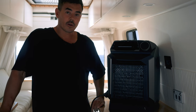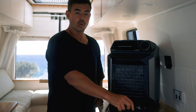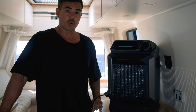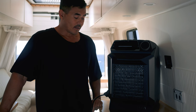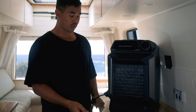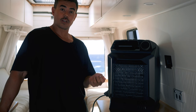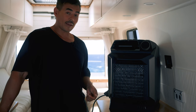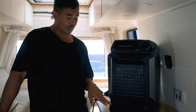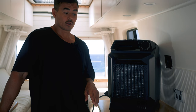There are a couple of ways to power the EcoFlow Wave portable aircon. Without the add-on battery, you simply plug it into the wall and turn it on. You can also power it from a Delta Series portable power station. If you have the add-on battery, there are three ways to charge it: first, with 240-volt mains power plugged into the wall; second, via a cigarette lighter in your car running off 12 volts — that cable is sold separately; and third, with 200 watts of portable solar, also sold separately.